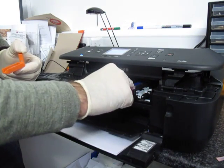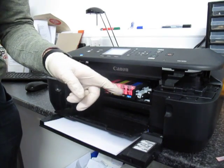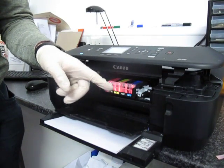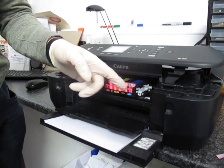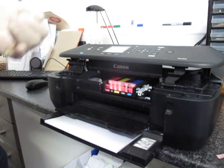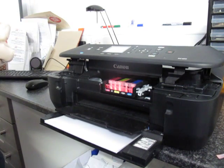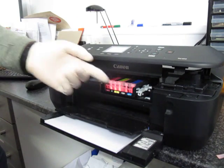The protective cover will be removed like this. We'll put the cartridge back into the carriage — it clips in. We have to make sure that the red LED light is on and not flashing. If you don't see a solid red light on the carriage, it means either the cartridge is faulty or you haven't put it in place properly.